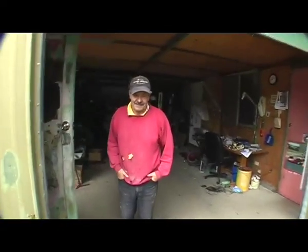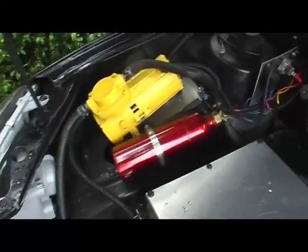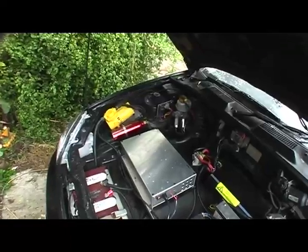This is Les, electric vehicle guru, who's happily giving me a whole bunch of advice. Look at this piece. So what is this? It's a vacuum pump for the brake booster. And this is storing the extra vacuum. And it's a $2 drink container — got two of those for camping. You need something that won't crush, because plastic would crush and suck in. But that's all you need; it doesn't need to be any bigger than that.